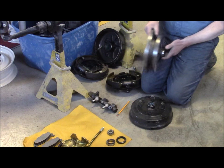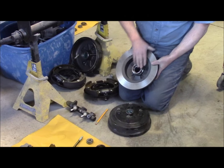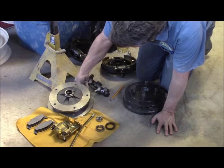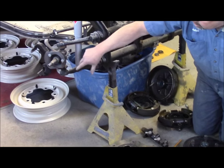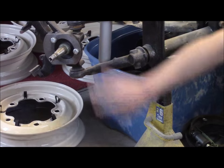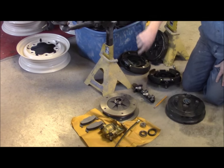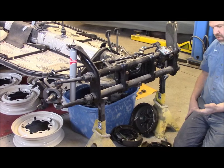So this is what it would look like. Basically, we'll pack the bearings, install the rear bearing and the rear seal, and the same thing with the outer bearing — pack that and install it. Once we have that done, we've already put the backing plate on, so it has the three bolts that hold it on, which will receive the caliper. Then the rotor is going to slide on there. Once we put the rotor on, we'll put the pads in the caliper and install them. We'll have that setup along with the flex hose, so we'll connect that.